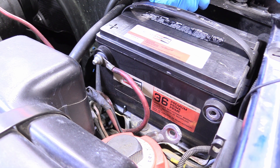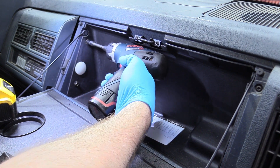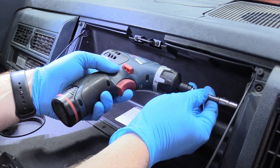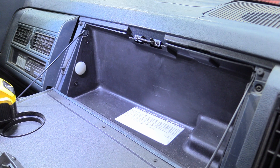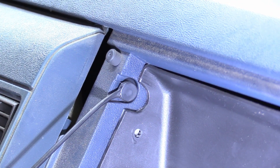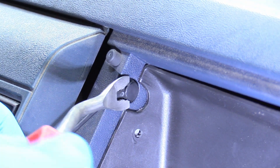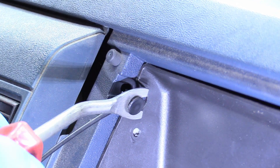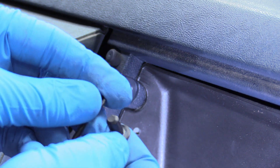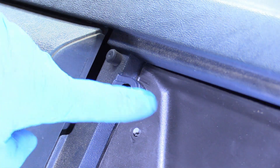Now I'm sitting in the passenger seat with the glove box open. I'm going to take a seven millimeter socket and remove the four screws that hold the liner inside this cubby — looks like I'm missing one, so it's only three for me. The glove box liner is also held in by the straps that keep the glove box door from flipping down into your lap. To remove those, use a standard screwdriver or a body clip puller tool — link down in the description — and just get the top out. Once you pull the plunger out of the body of the clip, the body can collapse and come out of the hole. There are two of those, one on each side.